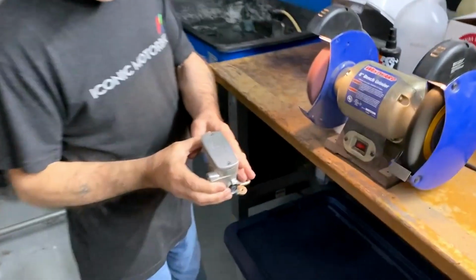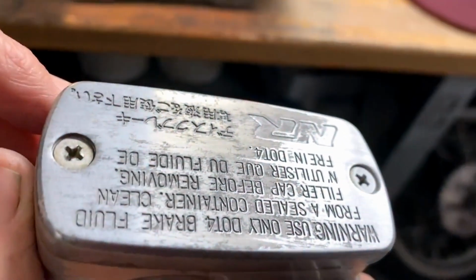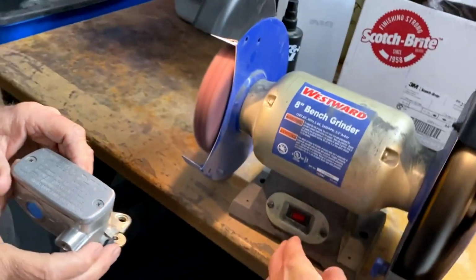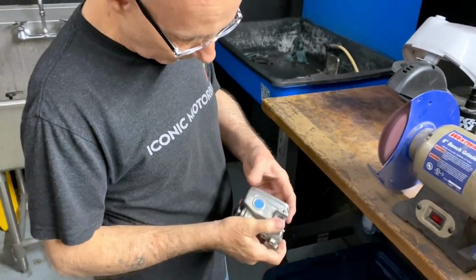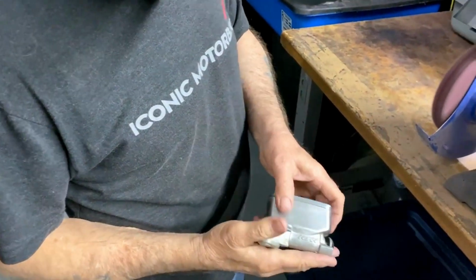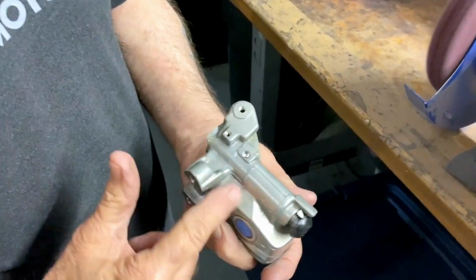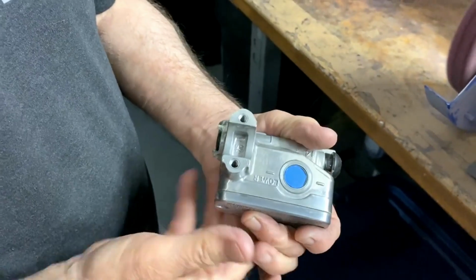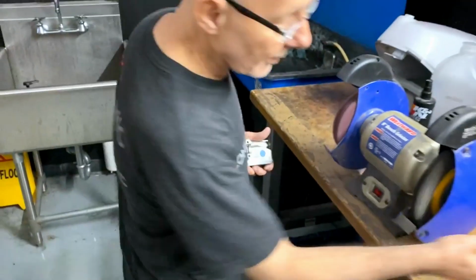It's already starting. You can see where the clear is coming off and it's getting cleaned up. Oh yeah, look at that. Okay, so tell me what the next step should be. Well, once I get all the areas that look polished cleaned up like this, then this stuff right here is really discolored and old looking. So I have to tape up all the stuff I polished and then bead blast it, and that's how you get the finish.